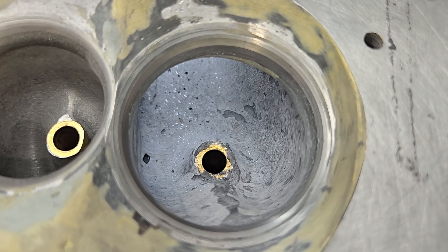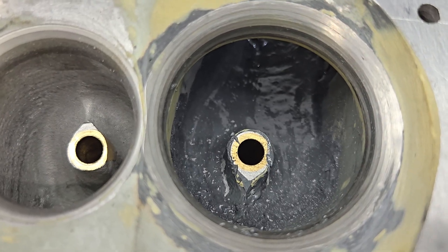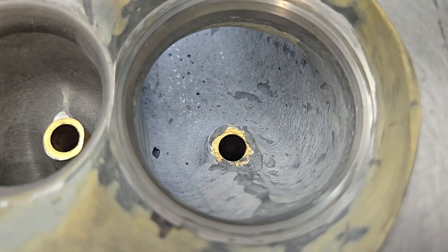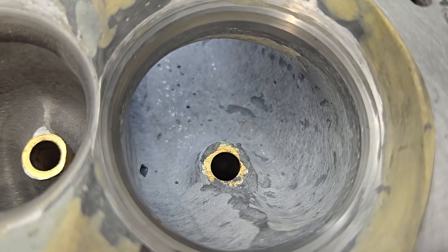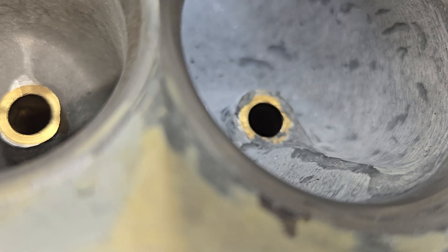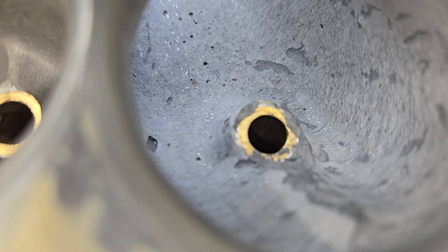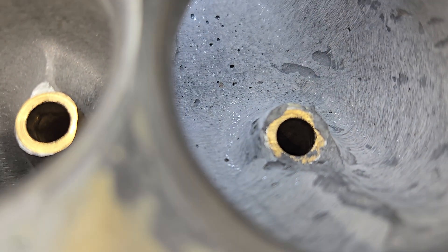Okay guys, we're back on the Olds head. I did do a little bit of work on the inside port, floated it stock, and then put a ton of epoxy in there. We're going to talk about the outer — it did get another coat of epoxy, but it still has plenty of lumps and bumps and not a smooth texture at all. You can see this is growing in height. I'm going to put a fin here and try to put a fin here to give it a little bit of aerodynamics.